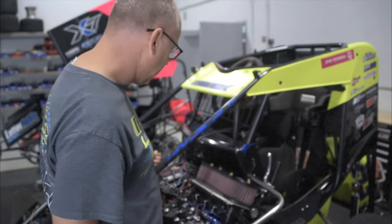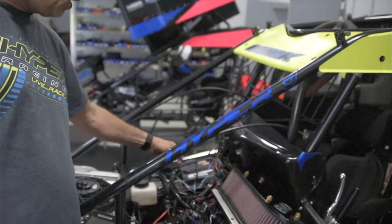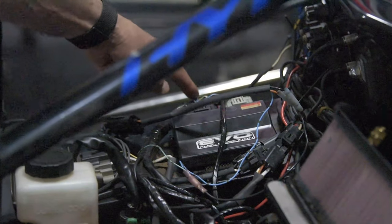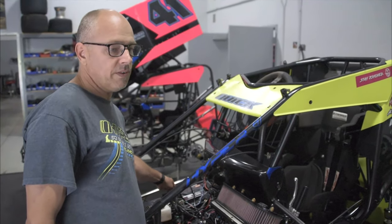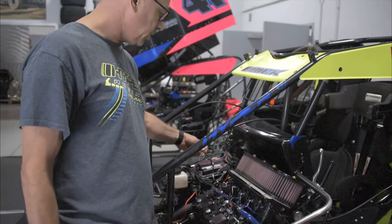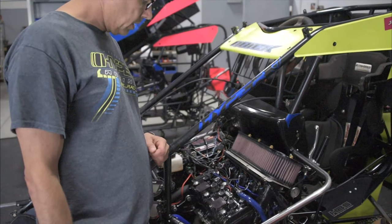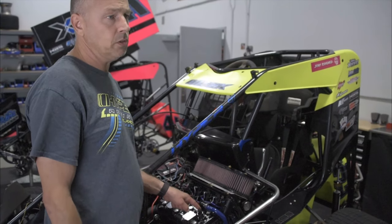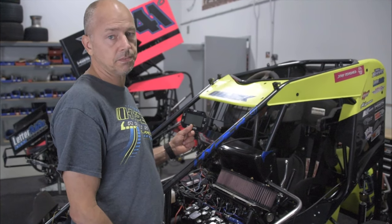If Brian Carver does your harness for you, he will have a wire hanging out of the harness that's for the Mychron, and he'll also have an ECU signal tack wire hanging out back here, or he'll have that run to the U6SA tack connector. The Mychron will not read off of the ECU tack signal. It has to use the coil signal, a high voltage signal. So you can also just plug your Mychron into this wire that Brian leaves hanging out of your harness for you. Since we're hooked up to the coil, every engine is going to have the same pulses per revolution, which is going to be times two. So in your RPM settings on your Mychron setup, just set it to times two.